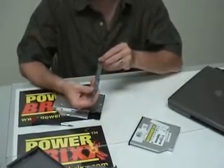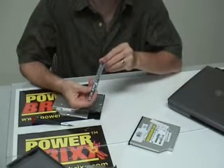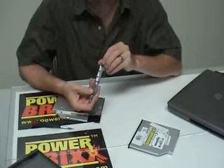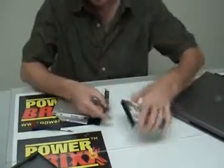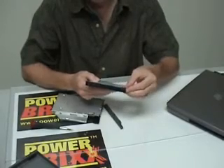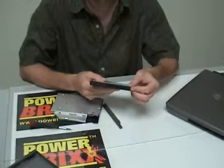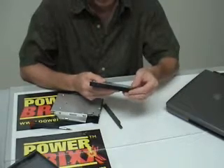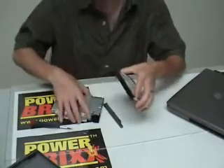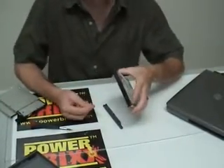There are a lot of these different bezels out there, and if the bezel is not the same as the one that's on your computer, then you are not going to be able to transfer your faceplate onto the new replacement drive. That's where it could be important to know whether the faceplate is the exact same width and height as the drive itself. If your computer would accept that without any problem, it might not fit perfectly, but it would install fine and function great. It might save you a lot of money over going to the manufacturer to buy one with the correct faceplate on it.